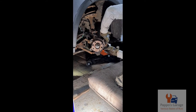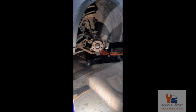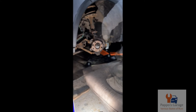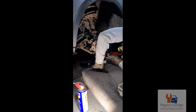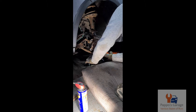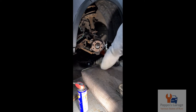So I'll get my ball joint splitter on it, get it seated properly, get it split. The thing is it won't split. I'd completely forgotten I'd worked on this car before and I'd actually double-nutted it. No amount of hammering and screwing would make the thing move, as I hadn't removed the other nut. The realisation is just coming over my face. I remember I'd actually threaded the thing, so I double-nutted it. So the damn thing comes back off again and I cut the thing off. I was replacing them anyway, but this is one thing that makes a job a lot more difficult and time-consuming than it actually should be.